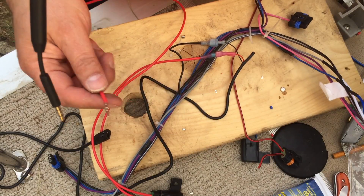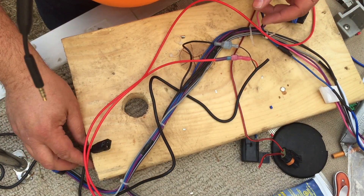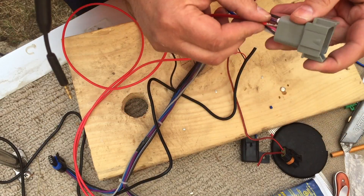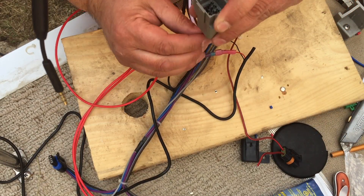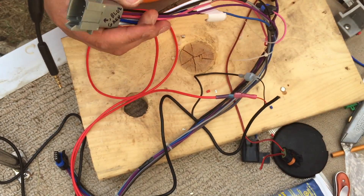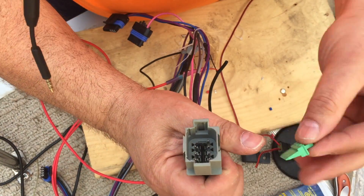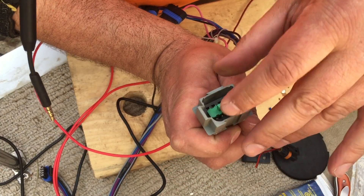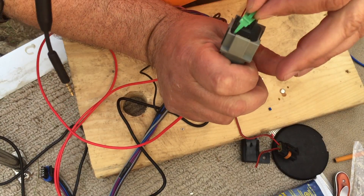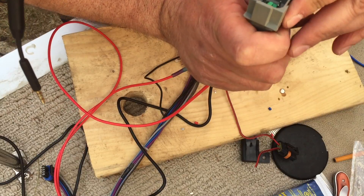I finished making the final pin, and that supplies a 3-amp fuse, which in turn supplies the fish finder's power-in cord. Now it's just a matter of sliding in the pin — it popped in there. I just need to find the little green wedge — here it is. This is what holds the pins in place. I don't think there's a left or right to this; it looks pretty much uniform. There we go — that's what holds the pins.